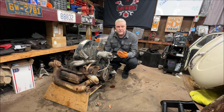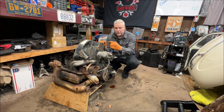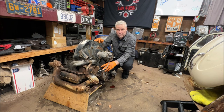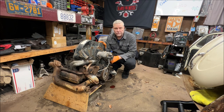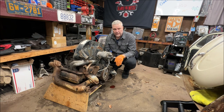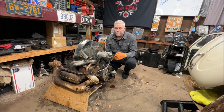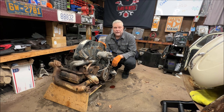I've got the motor tilted up on its side so the solution of ATF and brake fluid mixture can go around the whole piston. This chamber is still halfway filled where the distributor drive gear is — hopefully that gets down there and loosens up any issue. I already poured some down the intake. In 24 hours I'll get it up on its other side and pour it in that side. Even if I can't get it unfrozen, it doesn't matter — we're going to strip it right down anyhow. But I wanted to free it up first before taking it apart, as it would be a little easier. If it doesn't free up, we're just going to start ripping into it.